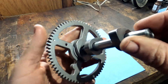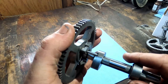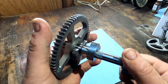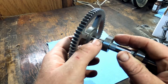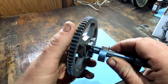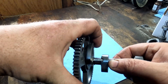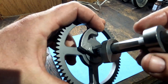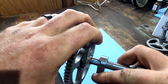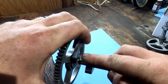I move the compression release over. When the engine's at rest, see this little guy sitting right here. As the engine spins around — I believe it's this way — as soon as it gets started and gets past a certain RPM, this guy opens up. And now, as you can see, when you go past the lobe again with it open, it should be laying completely flat, and you should be able to run your finger — there should be no bump there once you have it open.